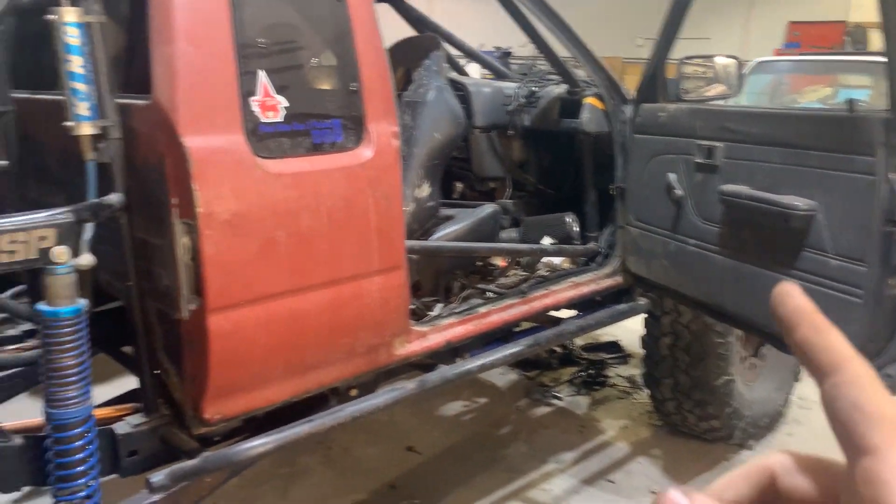I'll get a little more travel out of the front. Right now I get about 21 inches of wheel travel from full droop to full bump. I haven't jumped this truck yet because it's a little sketchy with the way my front suspension is set up — I don't have bump stops in it, and once again, they cost money. It's been a slow build over the years, but hopefully by the end of the summer I'll have this thing up and rolling again and maybe get some air with it. I've also got a sway bar going in because the thing has crazy body roll. It's the first truck I've ever built. If anyone wants to see the turbo process, comment below — it'd be cool to do some build update videos on this channel. Thanks, see you guys.